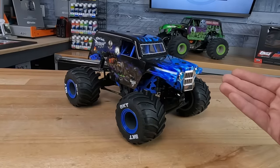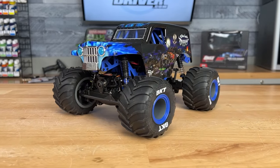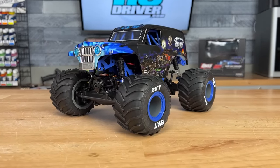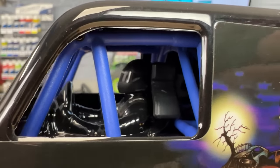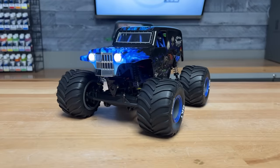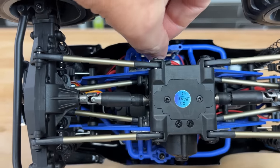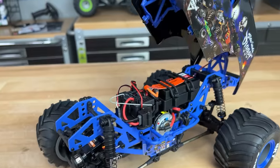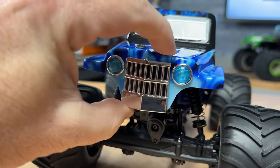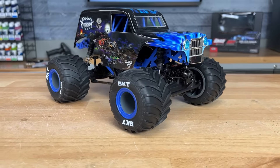Here's the mini LMT straight out of the box with the Son of a Digger Willie style body. It's a Lexan body painted on the underside — all the flames are paint, but the rest of the graphics are decals on the side panels and roof panel. The body is held down to an inner cage with a Lexan driver figure, a molded plastic helmet, chrome grill, and headlights with tinted blue lenses and LED lights behind them. The body is held down with little spin clips, though it does tilt the front slightly because they had to offset that front clip so it doesn't interfere with the servo savers.